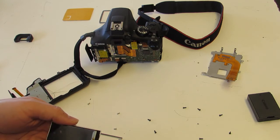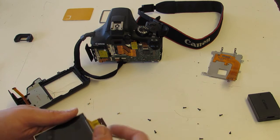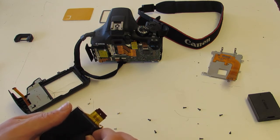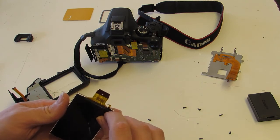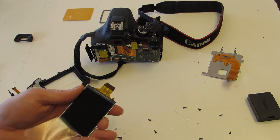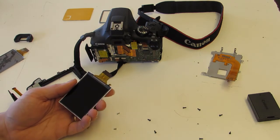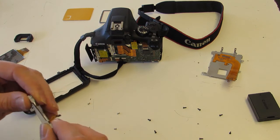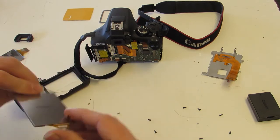Be sure that you've got the black side out, not the silver side. On mine, and I would imagine on most, there is a protective film you want to peel off your new LCD before getting everything put together. The protective film has a sharpie black stripe right across it, so if you forget and get the whole camera put together you're going to regret it — so definitely get that pulled off.